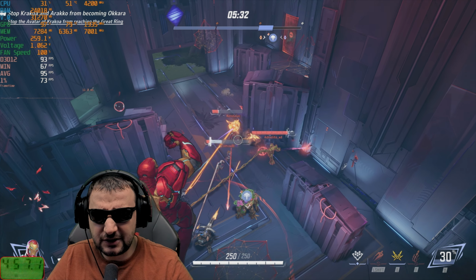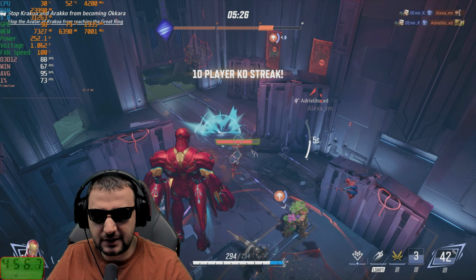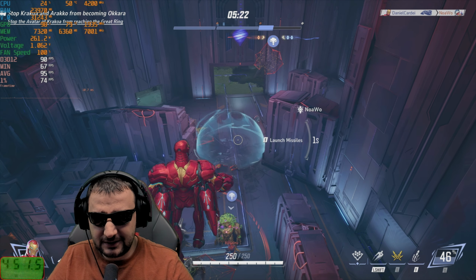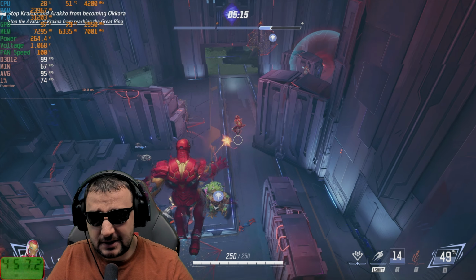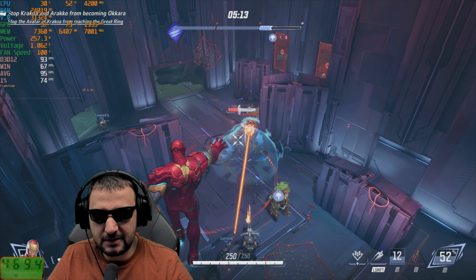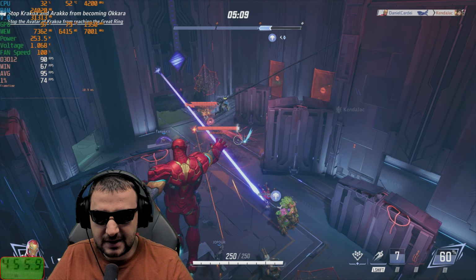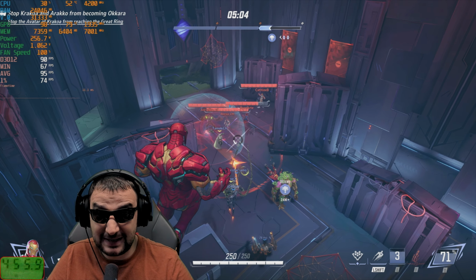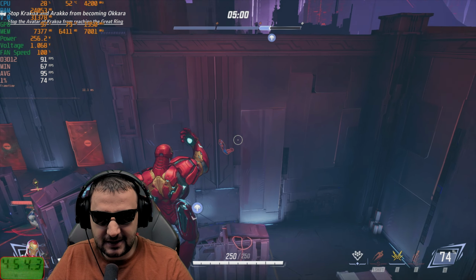It's doing a fantastic job, but you have to be very careful on the temperature side here. The video card can do it, but yeah, definitely in the right direction. It's okay. 80 degrees. I'm very disappointed because the video card should have been with better thermal paste in this case, because this MX4 is not rated apparently for 200 watts plus on the video card side. You can see it's struggling.